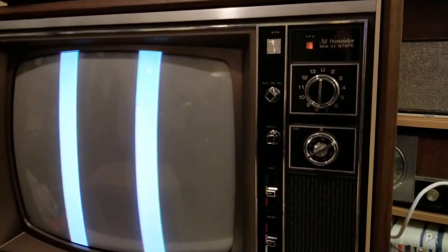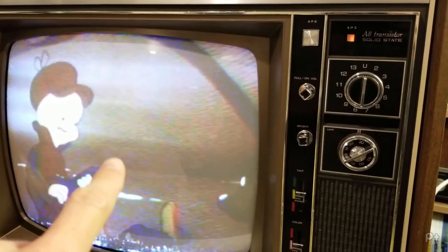Let's try playing an NTSC tape via the RF output. Interesting — this is that LP tape and I'm getting some color. This tracking issue is probably just a guide misalignment. Let's clean that up a bit — come on — it's about as good as it gets, but there is color. If I flip the switch over to another standard the color disappears, but cool — I get color on an NTSC tape via the RF out.